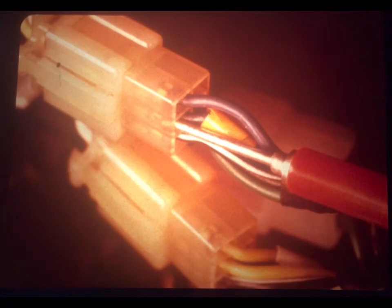Notice, too, that you'll need a wire to connect between chassis ground and the harness side of the connector to the pulsar pickup coil. This wire is used to simulate a pulse to operate the spark unit switch. You'll measure voltage both with and without that ground wire connected. Remember, the spark unit switch is normally open. The pulse closes the switch. Let's look at the test.